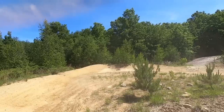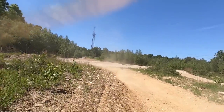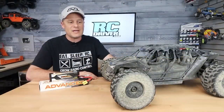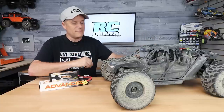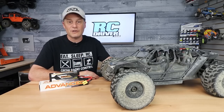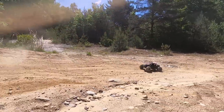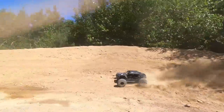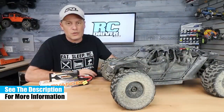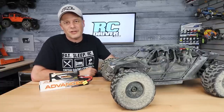The only things I would warn you about: obviously make sure you have the appropriate charger to charge up these cells — Gens Ace has that. And watch your temperatures — you've got a 10,000 milliamp battery pack in there, that is a big fuel tank, and in a big heavy vehicle your temperatures will go up, especially on an 85-degree day like it was today. I didn't run into an issue, but it's always something to watch out for. All right guys, let me know what you think about these new packs in the comment section below. While you're down there, hit that subscribe button and the notifications bell — I'll have links in the video description and we'll see you back soon for some more RC Driver videos.